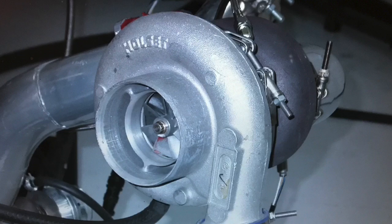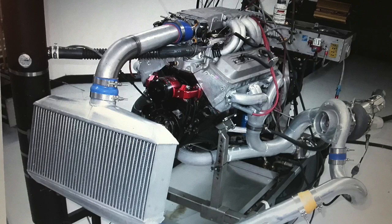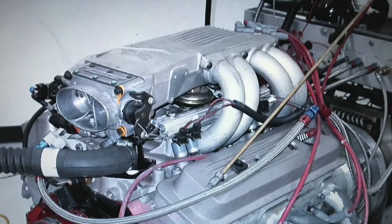The question is, for a lot of people, when we turbocharge a tune port, does it all of a sudden make this motor into a high RPM race motor? And the answer — spoiler alert — is no. Turbocharging always, on any motor, just elevates what's already there. So in the case of a tune port L98, which enhances a bunch of low speed power, we just elevate whatever the shape of the curve looks like from the factory. So if you've got a real torquey motor, you add boost, it's still a real torquey motor — there's just more of it. Because remember, boost makes everything better.